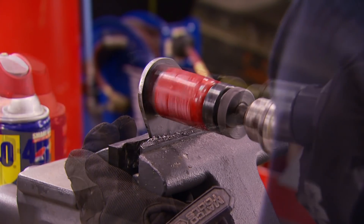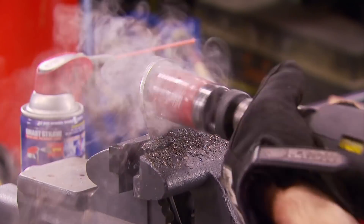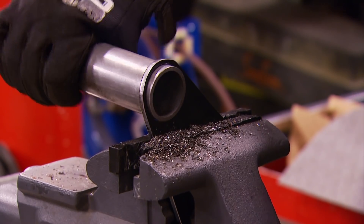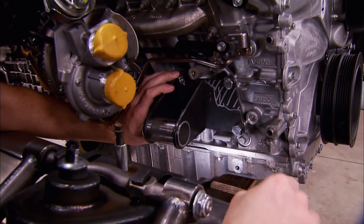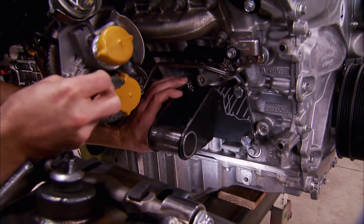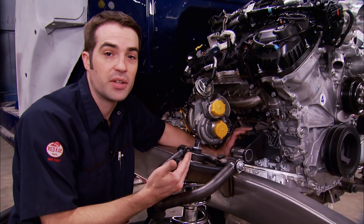With this engine mount design, the tube that holds the polyurethane bushing is actually going to pass through the side plate. I'm cutting the hole using our Matco hole saw and a little WD-40 to help the hole saws last longer. With the hole cut, I'm cleaning up the edges with a cylindrical carbide burr — don't forget your eye protection. With the second piece of metal cut out, here's what the mount is going to look like and about where we want it to sit on the plate bolted to the block — it'll clear the AC compressor and the turbo housing. I do want to plate the top of this mount to add a little more strength and to make it look nicer, but that wouldn't let me have access to that top bolt hole, which I definitely need. So I'm going to use a tube sleeve and a longer bolt so I can still plate the top of that mount and have access to that much needed bolt hole. Since I'm going to be TIG welding this, I've got to get rid of this mill scale.